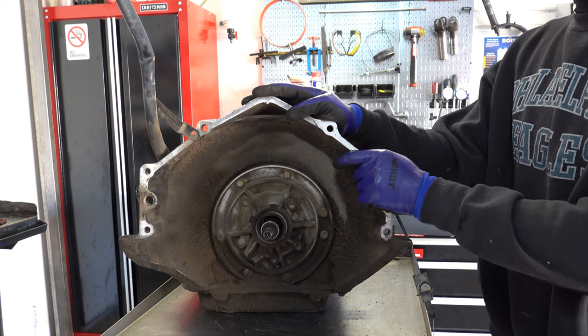Bushing here, it does get worn, it gets replaced, no big deal. Ring gear, you want to look for flattened lugs, lugs that are overly worn, lugs that have a lot of deep grooves cut into them by your 3-4 clutch pack. And in cases of extreme lubrication failure related problems, the 3-4 pack will actually weld itself to this hub. And I mean, you can eventually get the drum out, but it'll take a lot of effort.